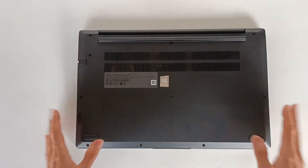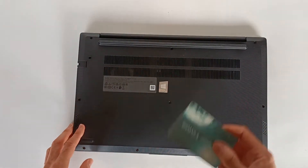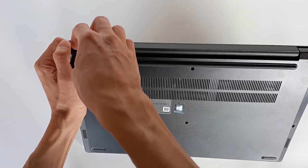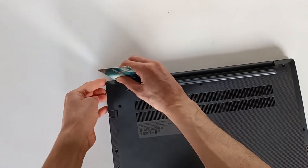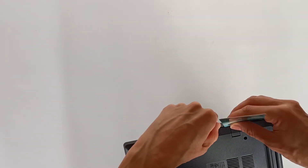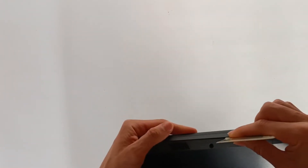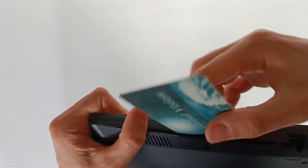We are going to take off the cover, but the lid still doesn't lift — we'll need a card or some other kind of tool to unclip all the clips and separate the cover from the computer. We'll start by pulling one of the corners and inserting the card into the slot of the space you create, trying to make the separation between the cover and the computer. Do this carefully and calmly so as not to break the fittings. Separate all of them one by one all around — in some parts it can be more difficult, but it opens little by little.